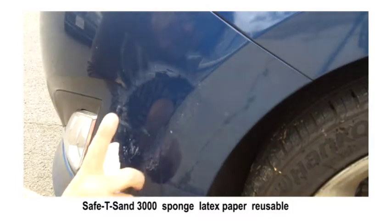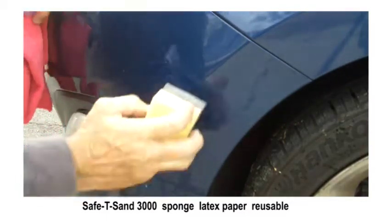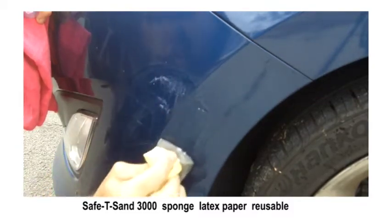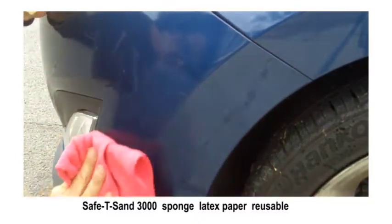Not the whole thing, and we're not going after the really deep gouges. You can't really fix those — wet sanding actually works against you on deep gouges. You actually want them deeper so they'll hold the paint. Right now we're going after surface clear coat scratches that can be permanently removed. We're going to wet sand them out and then polish them.